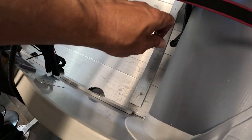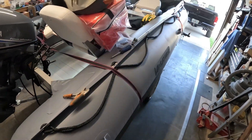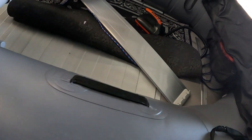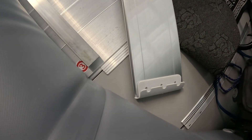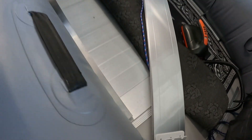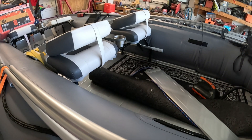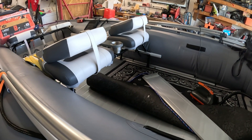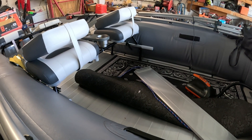I made sure the screws will not penetrate and screw up anything on the boat as far as the bottom and the fabric go. I've started drilling and running screws in — I need to put one in the middle there but the seat's in the way, so I'll do those last. I'm running it all the way up to the front just shy of where the wood begins, because that front section needs to flex. The whole floor is completely flat — when I laid the aluminum bar on there I was shocked it was actually perfectly flat.